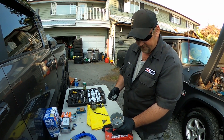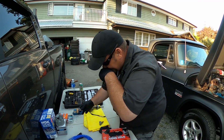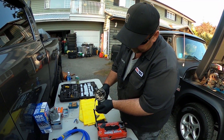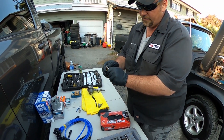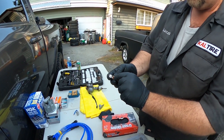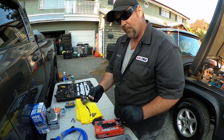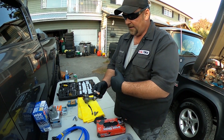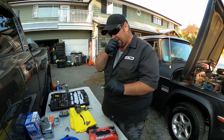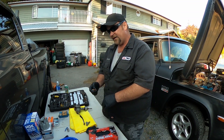You may ask how does points ignition ignite? This is a condenser — it stores and condenses energy. Much like this distributor, as it passes a signal, these breaker points go in that distributor and as they open and close it sends a signal. There's the rubbing block — when you install these, they have to be gapped properly with feeler gauges and the rubbing block must be lubricated, otherwise it'll wipe out quickly. If you're looking to get into old cars, a lot of them will have these. There are also alternatives like MSD, Pertronix drop-in systems.